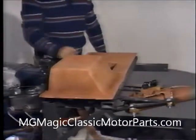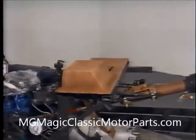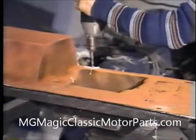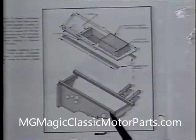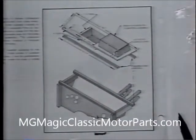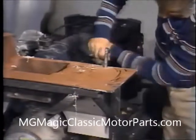We could use rubber weather stripping or good quality silicone sealer if preferred. The battery box is centered, allowing it to overhang the chassis an equal amount on each side. If necessary, we may need to trim the sides slightly when we install the body. Following the instruction manual, we use our electric drill to drill holes through the front and rear mounting surfaces of the battery box, then use hex washer head self-tapping screws to secure the unit to the chassis. Later, long bolts will secure the body to the frame going through the battery box.